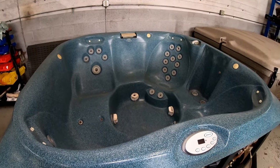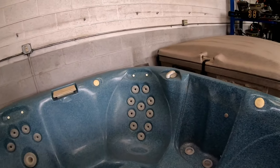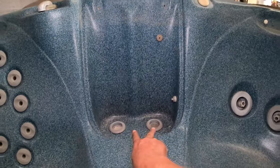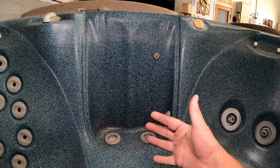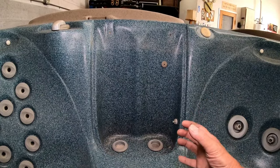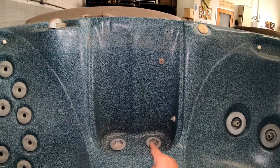This is the typical hot tub that I work on all the time — this is a Jacuzzi J335. The first thing I would tell somebody before they filled this hot tub up with water is take out the two filters. If the filters are in, it'll cause it to be kind of like suffocating the hot tub, where it's not getting the proper water going into those two tubes. So that would be the first thing to do before you turn on the water.